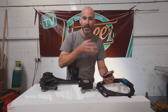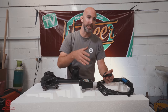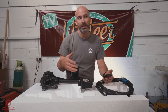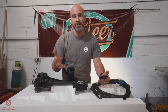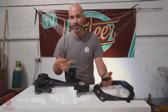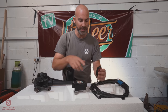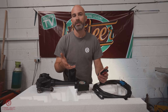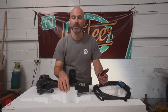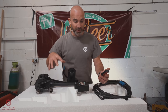You would rely on the signal from the coil in an older air-cooled engine. Splitties and other buses now are having a lot of engine upgrades or engine swaps, such as electric motors or diesels or a Subaru conversion, and not all of those engines will provide you with a coil live. So having a GPS unit is kind of twofold. Not only will it give you a more accurate reading of your speed, but it will provide that coil signal as well.